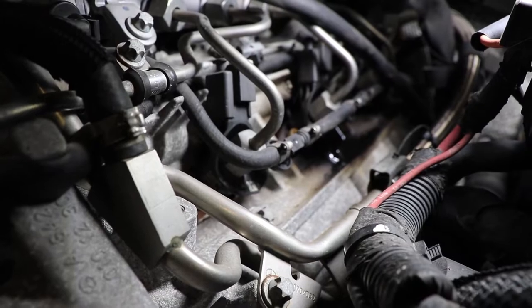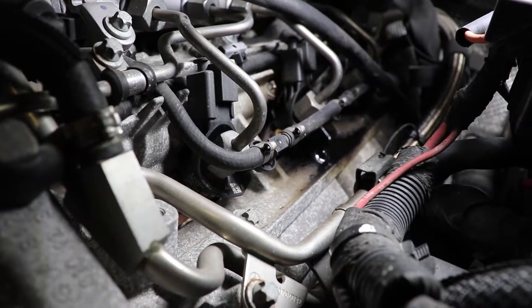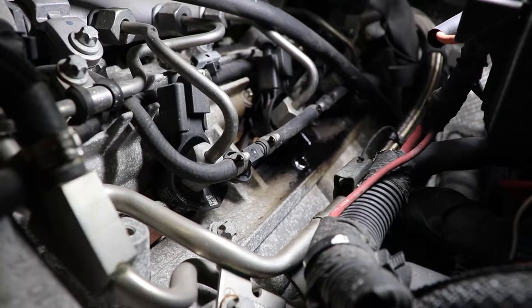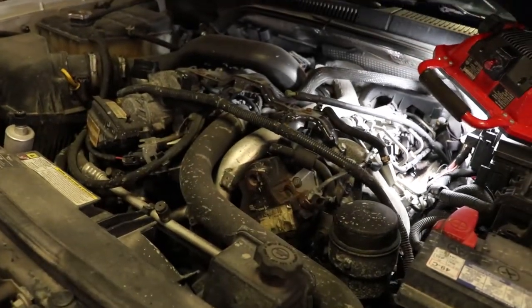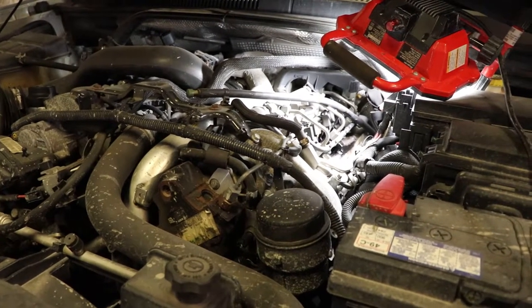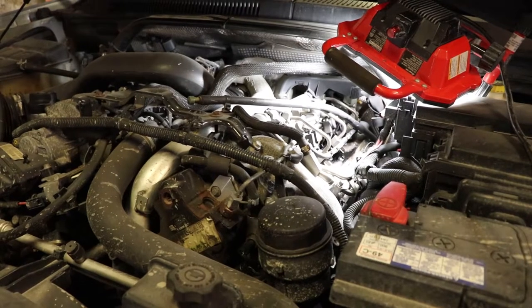I'll get the vehicle going so you can see it chugging. I've been told you need to do this job warm, because the crusty stuff is pretty hard when it's cold but kind of gooey when it's hot. I've also noticed my oil consumption has gone up — I don't know if it's because that cylinder is basically not firing, just blowing fuel out the exhaust and head, and it's probably not very good for the particulate filter either.